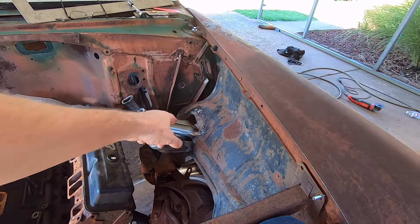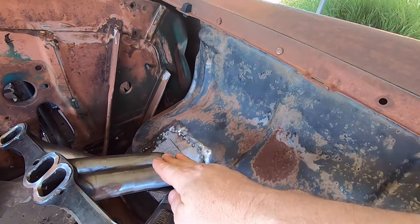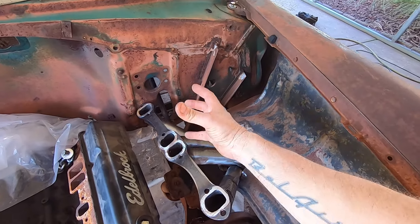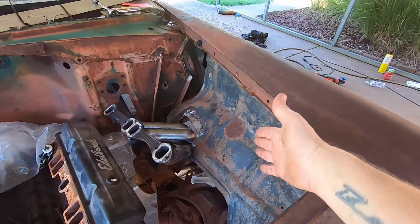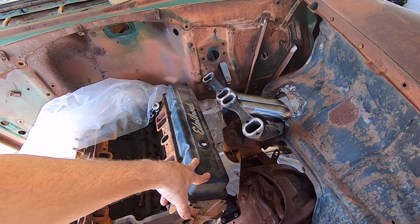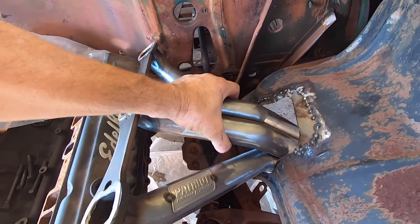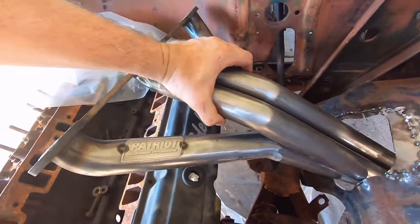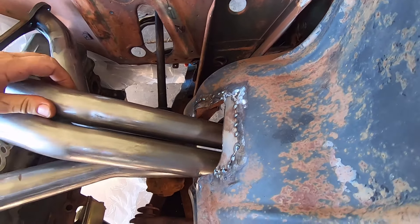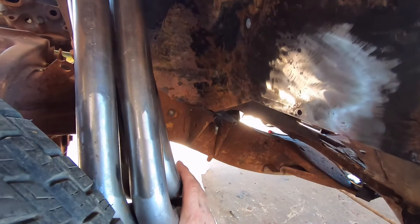I've already kind of winged it and it bit me - I had to go back in and reform a piece. I tried doing a larger opening up top because when you're pulling the header out, I wanted to be able to put the collector of the header down through there and feed it down, then bolt it to the engine with the engine in - you know, painted inner fenders and all that. It's proving to be a bit of a brain teaser. The problem is when you try to pull the header out, it's already touching the valve cover, and I'm going to be running tall valve covers so those will be even taller. The collector is hitting the frame right here as I'm trying to force it through.